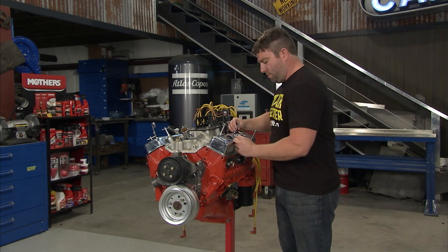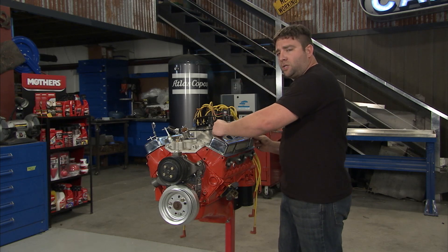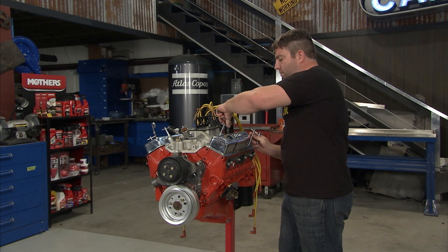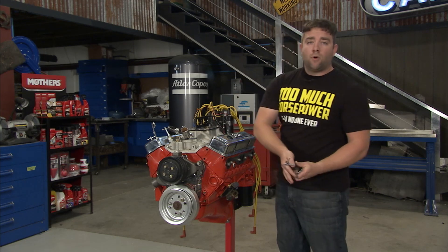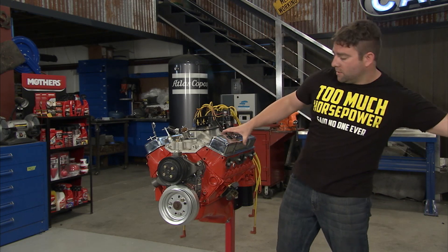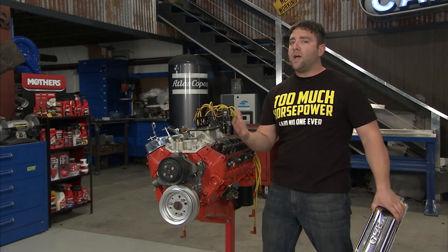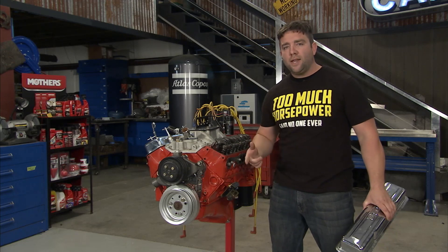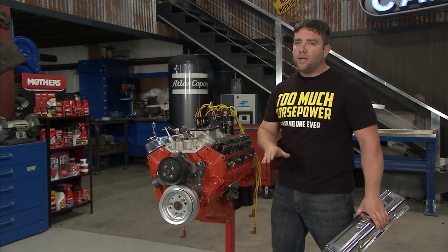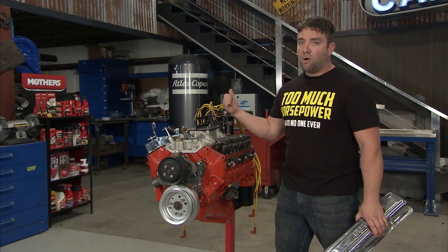This is where it gets tricky though. We want to look at where the piston is at relative to the combustion cycle, because just being at TDC isn't good enough. The crankshaft in a four stroke engine revolves twice for every one revolution of the camshaft — that is how you get 180 degrees out. If the engine fires on the wrong stroke, on the exhaust stroke, you're 180 out. That can cause backfires and all kinds of problems, and can even cause a fire because essentially you're sending an explosion the wrong direction.